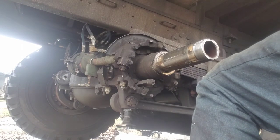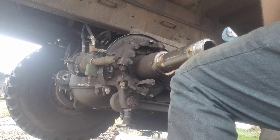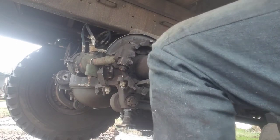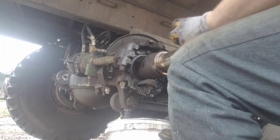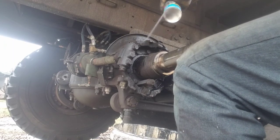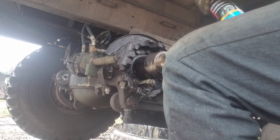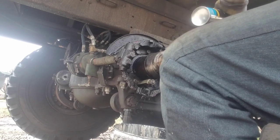Make sure all your wedges are down all the way. On your shoe you're gonna have some dust in there. Make sure you get it all cleaned up and spray it down. Try to get some of the brake dust and everything else out of there. There's a lot of grime and crap on this one — it hasn't been off in a while. Of course this is your ABS sensor — you do want to make sure that's all cleaned up, not torn up or gunked up, otherwise it'll give you a false reading and make it engage when it doesn't need to.